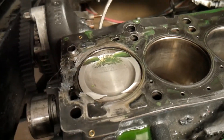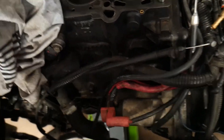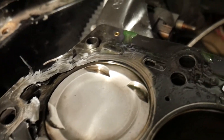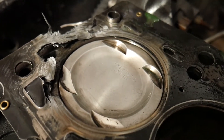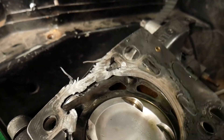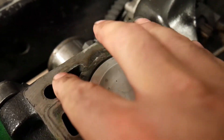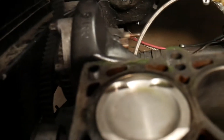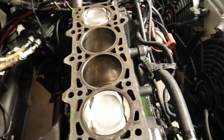There's the damage. Looks like our piston was fine — let me wipe the coolant out of the cylinder. Now we can see it just pushed out the side there. There's no damage to the piston whatsoever, but that gasket sure did fail. Taking a look at our block, looks like some minor scoring on the block. Going to get Shannon over here to take a look and make sure the block is okay — everything else looks good and all the other pistons look good.